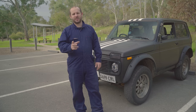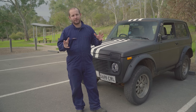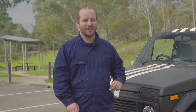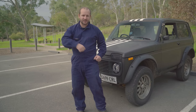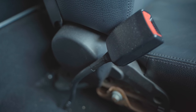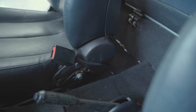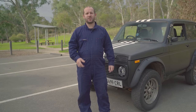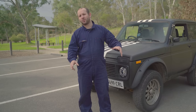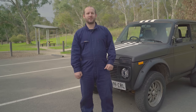I touched on this before — the Subaru Liberty seats being put into this car. The major change needed to make it legal was the seatbelt. The original seatbelt clasp was attached to the seat rather than the frame of the car. We had to attach it to the frame, so we put stalks into the original ladder mounting spots and now the seatbelt plugs straight into those. The engineer came by, checked the seats, confirmed the bolts were correct, signed everything off, and we now have a certificate allowing the Subaru Liberty seats.